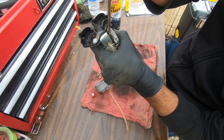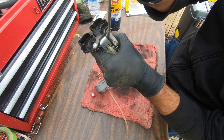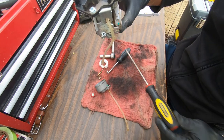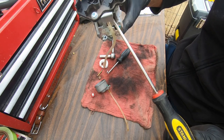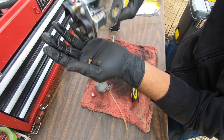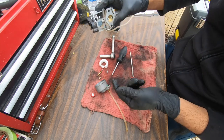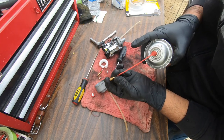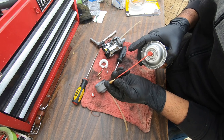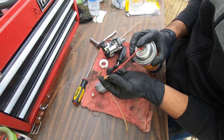Be patient, don't strip it, and pull it out from the side. It seems like we got lucky — just before it hit that other screw it came all the way out. I didn't want to mess with that because that messes with the adjustment on the throttle. So we're gonna go ahead and insert the hose at the holes on the bottom, spray slowly, and see it come out of the other holes.